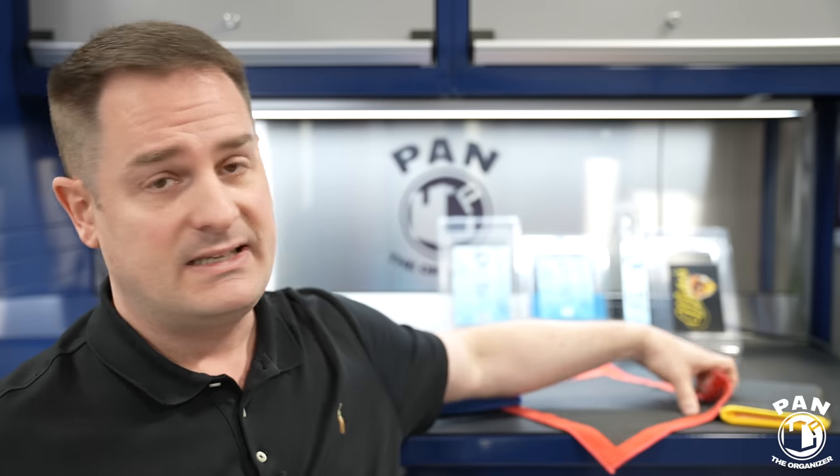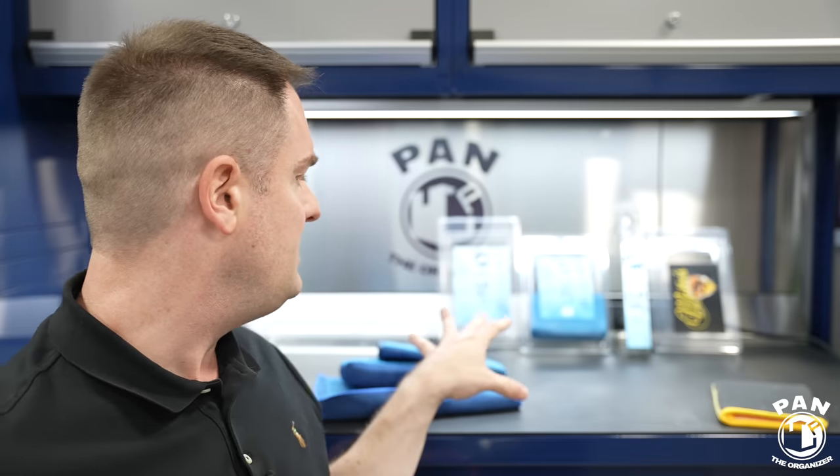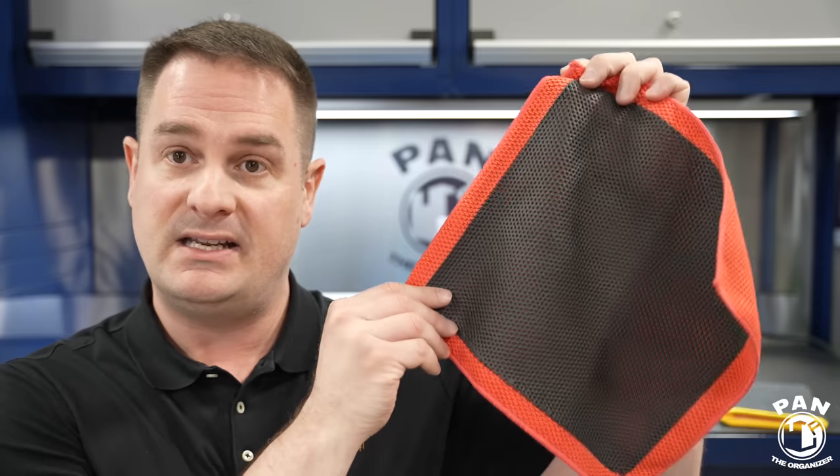From the Rag Company, the grade is fine for all three of their media. They also have an ultra clay bar. The DIY Detail media is ultra-fine, on the lighter side for moderate to medium contamination. If you have a lot of heavy contamination — the surface feels more like sandpaper — you may have to move on to a traditional clay bar. They're more aggressive and will pull more dirt, grit, and grime out of the paintwork if that's what you need.